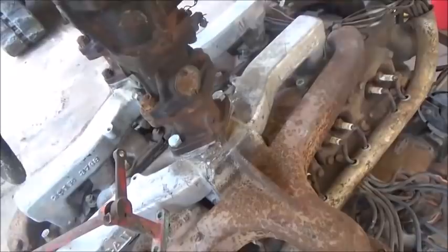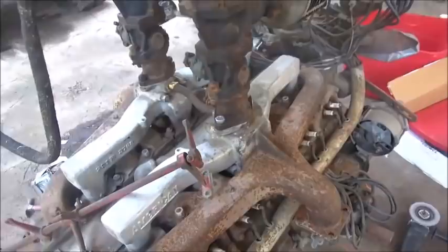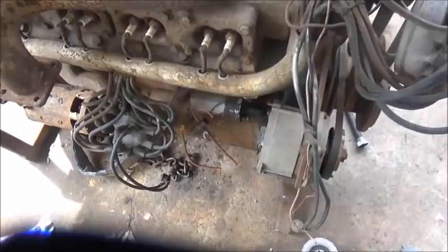I've got to make the gaskets — we're going to do that real quick. It won't take but a couple minutes, just two gaskets for the base. That should take care of that issue. I was missing a freeze plug in the front, so I just pipe tapped it — one inch — and put a pipe plug in it. Should be good to go there. Of the two distributors, I've decided to use the upper one. We'll wait on the other one and decide what to do.